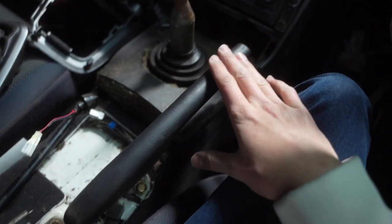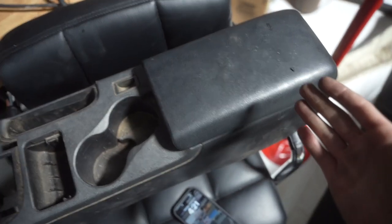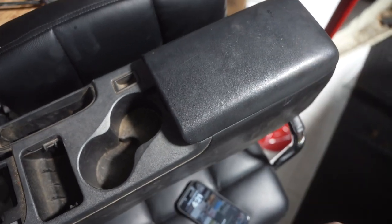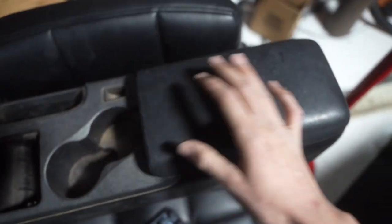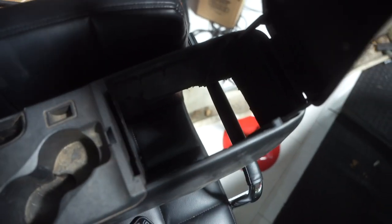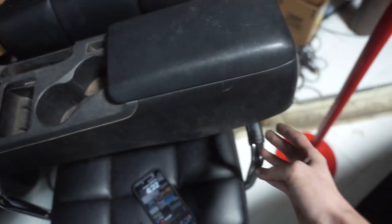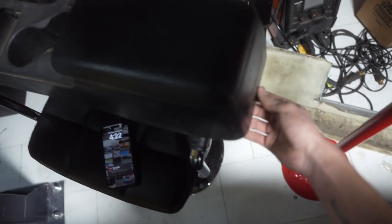GK Tech has a video doing everything, so I'm gonna follow it to the T. I was gonna clean this center console now that it's out, but it's pouring rain out there right now. I did cut out the inside — I used the angle grinder, so the cuts aren't the prettiest, but nobody's gonna see that because it's always gonna be closed. One thing that is concerning though is that the only mounting points left on this center console are these two, because they cut the others out. On the S13 and S14s it has two on the side, but if anything I could just build a bracket to hold it down.